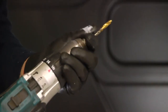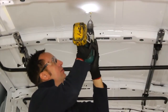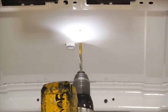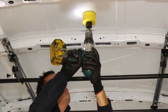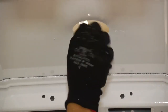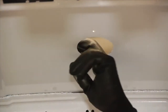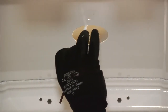Next, open up the two fixing holes with a drill fitted with the 5mm drill bit. Finally, open up the centre hole using a 6.5mm drill bit. Next, using a 75mm to 98mm hole saw depending upon which base you are fitting, proceed to cut the hole for your vent in the roof of the vehicle. Carefully remove any burrs from the cut edges of the hole using a metal file. Once you have done this, use a good quality rust inhibitor to protect the exposed metal surfaces against corrosion.